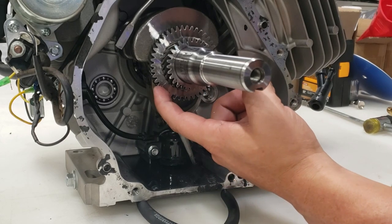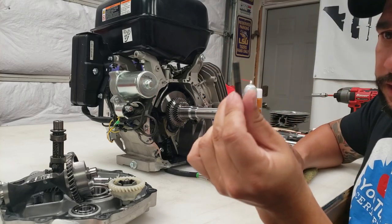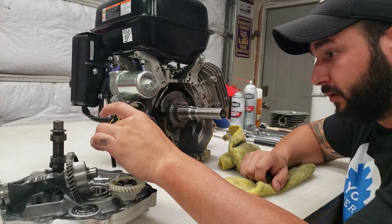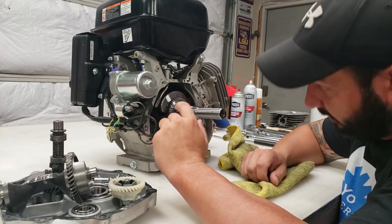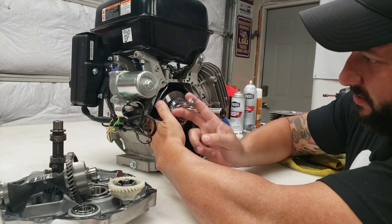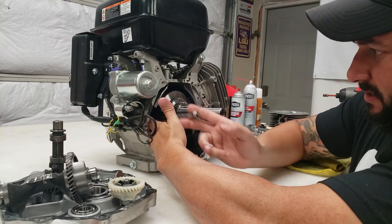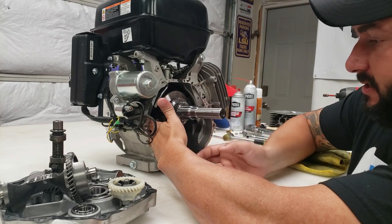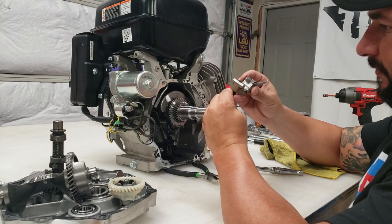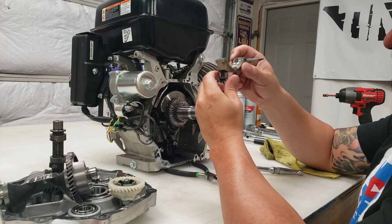I'll also have to pull this crankshaft and see if it's severely damaged or not. The threads still look okay — I don't see anything major wrong with them. So I think it just maybe weren't torqued from the factory, or maybe it's because I was running it at like six bajillion RPMs. That bottom bolt came out with no issues. This one's not very tight — almost like the threads are messed up or something, because this thing should spin out pretty easy and it's not wanting to. That bearing is gone, and it's also why the bolt is not wanting to come out — the actual bearing surface is eaten into the bolt.